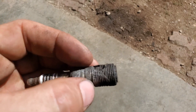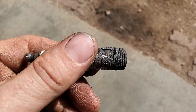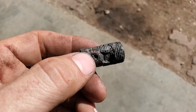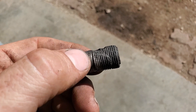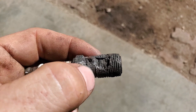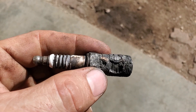It's only pulling on the threads, which is like having a loose spark plug, and then this is going to vibrate up and down. I think that's why this one failed. My theory is if we put a helicoil in where the spark plug seals on the cylinder head, the spark plug will pull on the threads of the helicoil and seal up against the cylinder head — it'll stay pulled tight and won't have the opportunity to vibrate back and forth on the threads. That's why this insert repair kit failed.